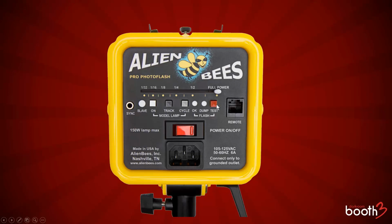Okay, over here on the right hand side, you've got a test button. Now some people will tell me, oh, my flash is not going off when it takes the picture, but when I press the test button it works just fine. Okay, that just means your flash works. That does not mean that the camera is triggering the flash. So it could be a problem with the cable connected from the flash to the camera. So you want to check that, not just push the test button here.